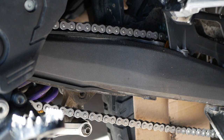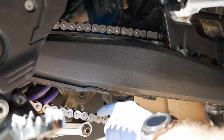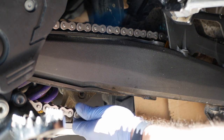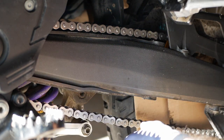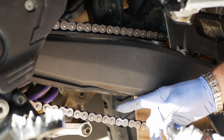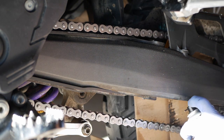The sprocket is still in good shape — it was changed front and back. Now we'll grab the lube. When you're lubing the chain, you want to make sure you put the lube where the o-rings are, on both sides. Just enough to get the o-rings lubricated and the moving parts moving freely. You can check along your chain for any stuck links or missing o-rings. I have the cardboard in here and I'll do a little squirt.